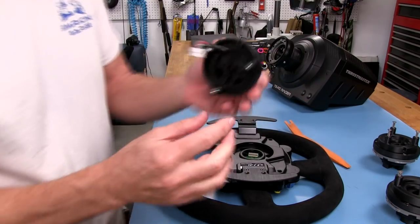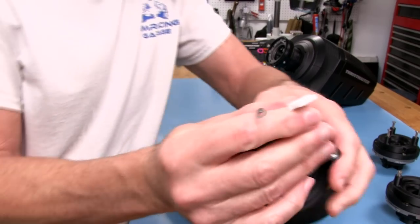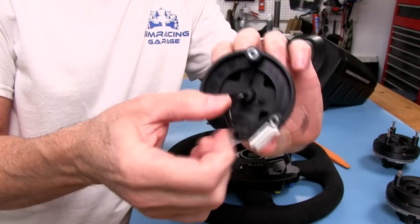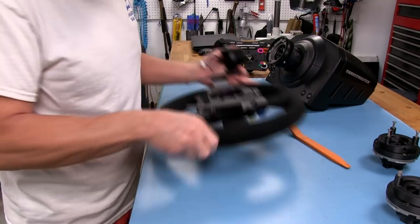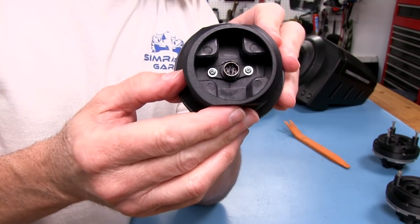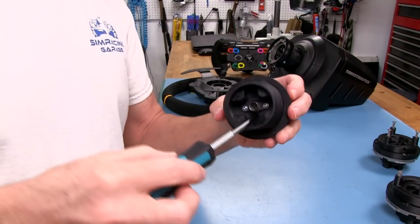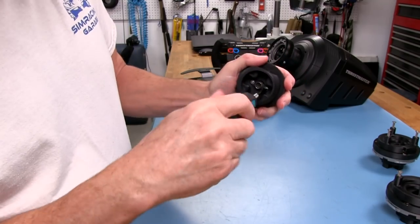There we have it — this is a six-pin Molex plug, very common in electronics. Now we're going to take this plug bracket out as well. You can see we have two Phillips screws. We're going to take those out again with our Phillips screwdriver. It's not rocket science to take the screws out, though it's a little more tricky to get the plug to come out. I'll loosen one and then the other because I don't want one binding up if I take one all the way out without loosening the other first.